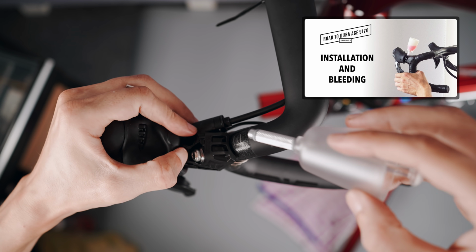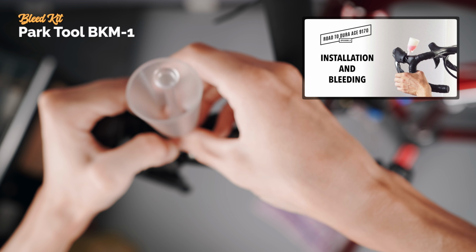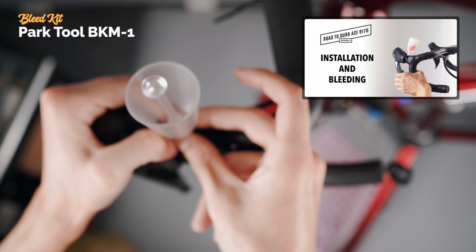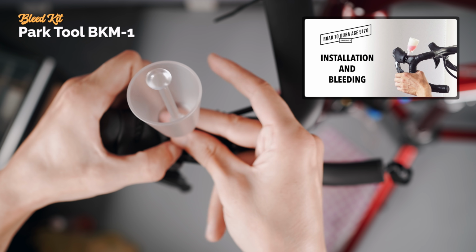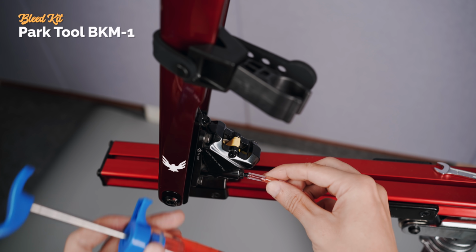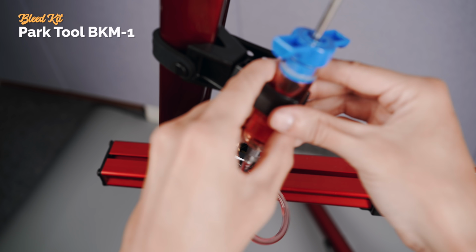So just like with the Trek build, I will not go super in depth here. If you want a more in-depth bleeding tutorial or installation, check that video out. I will leave a link in the description. But a quick rundown: bleed funnel at the lever, and as this is a dry system, I will use a syringe to push the Shimano mineral oil from the caliper to the lever.